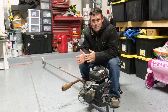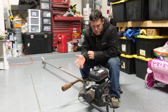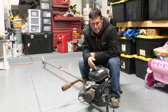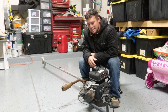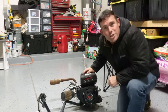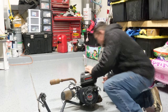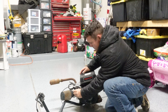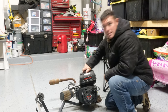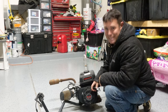Taking a trolling motor with you is always a good option because you never know when an engine might go down — the carb can go bad, floats can get stuck, all kinds of things can happen. But I literally have not started this thing in probably two months and it's about 20 degrees outside, so we're gonna try to start it to show a little bit of the dependability. Switch is on, choke is set, gas is on — it's got gas. It's like 20 to 30 degrees outside right now so it may take a couple of pulls.